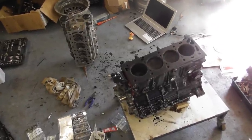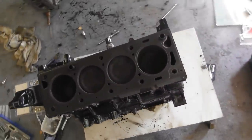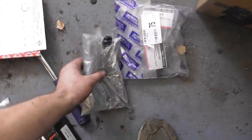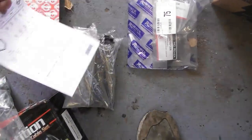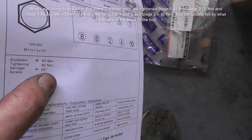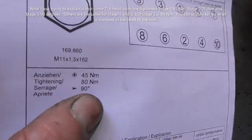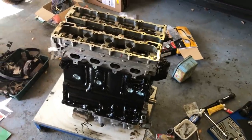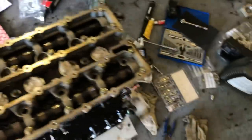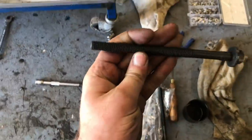Exciting times. Head gasket fitted, mating faces all cleaned up. Now I'm just going to lift that on. The kit came with these bolts and they have tightening torques and sequence on the packaging. Some T-series bolts are 70 newton metres; these are 80 and then a further 90-degree angle turn at the end. Change of camera because I've run out of batteries. Cylinder head lifted on — I'm just going to get a bit of oil and put it on the threads of the new bolts so that they torque up consistently, and under the heads as well.